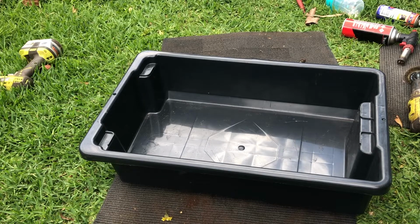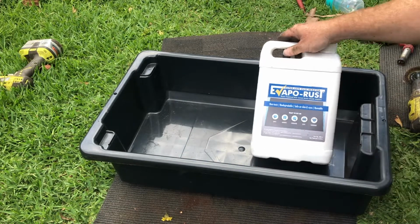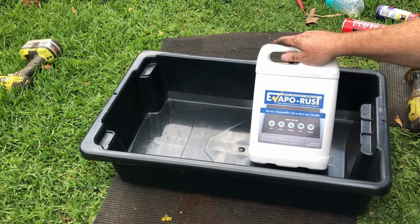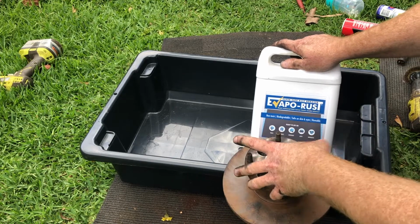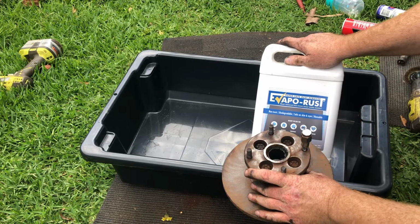Okay, well I've got my tub, and what I'm going to do is put my discs in there and fill it up with Evaporust. Now, not sponsored obviously, but this stuff should get the rust off. I'm going to leave it in there for about a week and then see what it's like, and if it's any better, then wire wheel them up and then send these discs off to my disc man, my brake man, to get them machined. But let's see how we go.